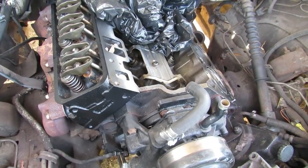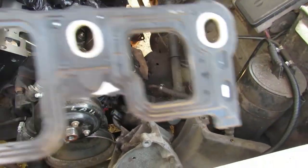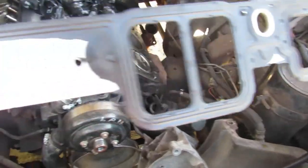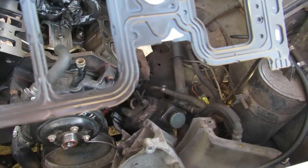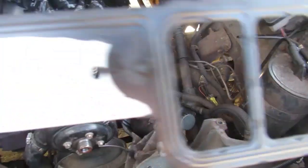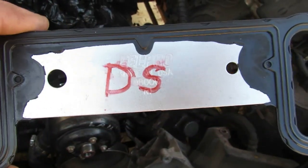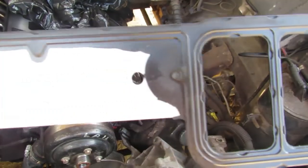Let me talk a little about gaskets. These intake manifold gaskets - get the ones with the metal backing and rubber. I'm going to reuse those because they only stayed clamped down overnight before I figured out the head gaskets were blown. These are Fel-Pro - I only use Fel-Pro gaskets. Get the one with the metal; these are going to last a long time. I also marked which side I took them off of.